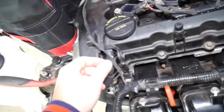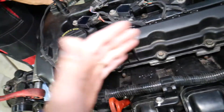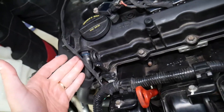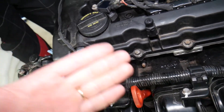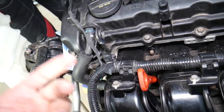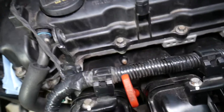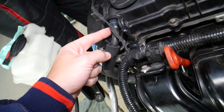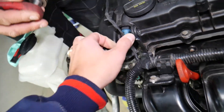We're going to remove the upper engine cover. Right here on the valve cover you can usually find your PCV valve — the location may differ depending on the generation, but it will have a hose going to the intake manifold. The purpose of that valve: when the engine runs, the pistons go up and down creating pressure. If that pressure doesn't come out, you'll develop multiple oil leaks, start pushing engine oil through the intake, end up with bad crankshaft seals, and even damage the head gasket — all because of that little valve. It can make you think you have a bad engine and cause serious smoking.